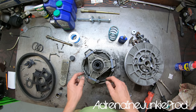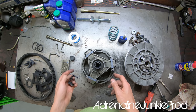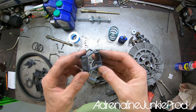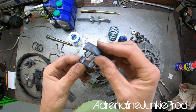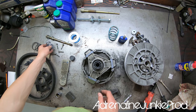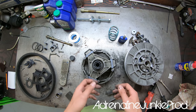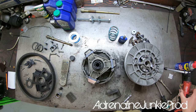I'm told I can't just replace the triangle spider section because it's balanced with the rest of the clutch assembly — technically I'd need a whole new primary clutch assembly. For this season I think I'll get at least another year out of this setup, and if I keep the Razer longer I'll just get a new primary clutch. I swung by Grand River Power Sports in Brantford, Ontario and they removed the spider for free — they look after me pretty well there.